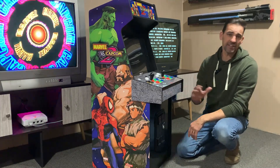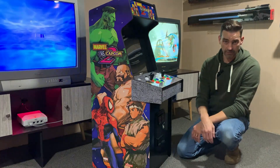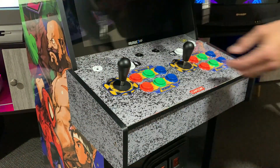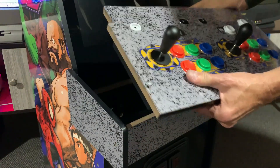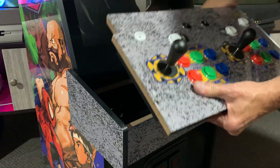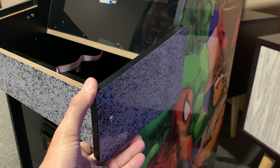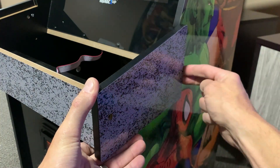I have a super easy solution that's going to take care of all this for about eleven dollars. The first thing to do is remove the four screws and unplug the two cables that secure the control panel to the cabinet, which gives us access to those two side panels. Inside you'll find four screws that need to be removed, plus one through-bolt on the outside. Then repeat the process on the left side and take both panels over to the table.